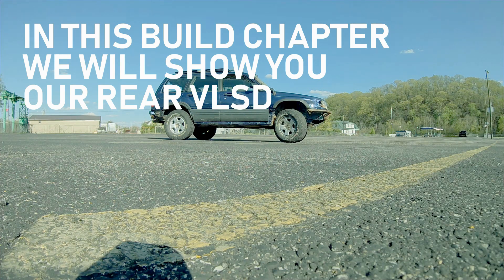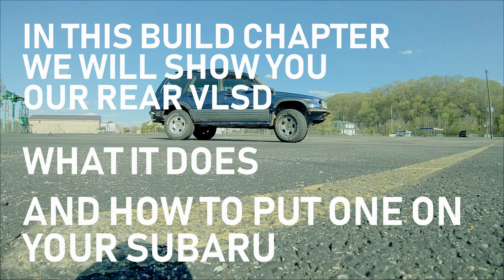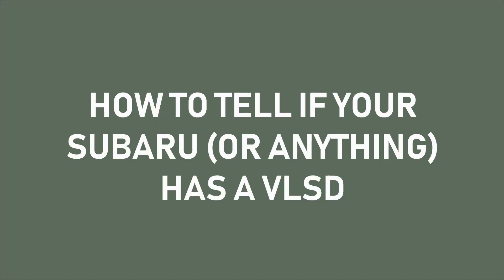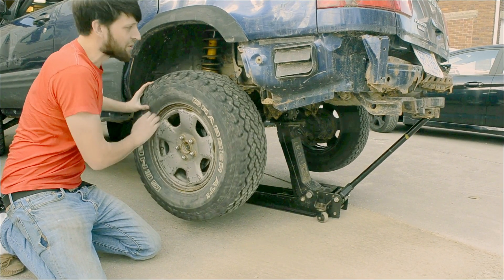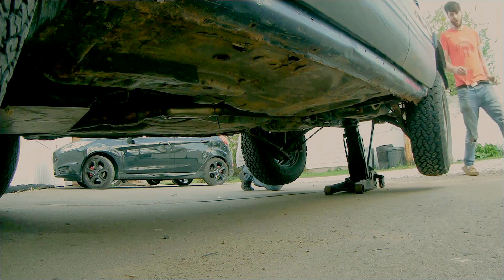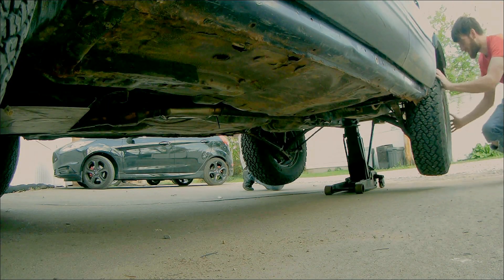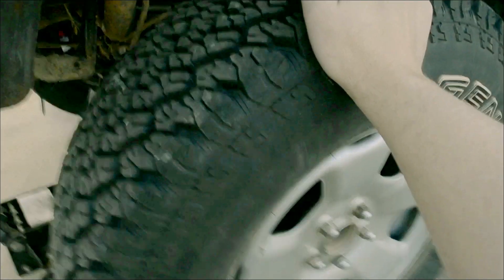Otherwise a sensitive complex thing. So here's how you know this is a limited slip — turn this wheel, the opposite wheel turns the same direction. If there's an open diff, that other wheel will be turning the opposite direction or not at all. If I hold this and you spin that, see how much torque you get to that side — not much. I feel it a little bit because it's a viscous. The faster I turn it, the more they get. That's the effect that you're paying for.